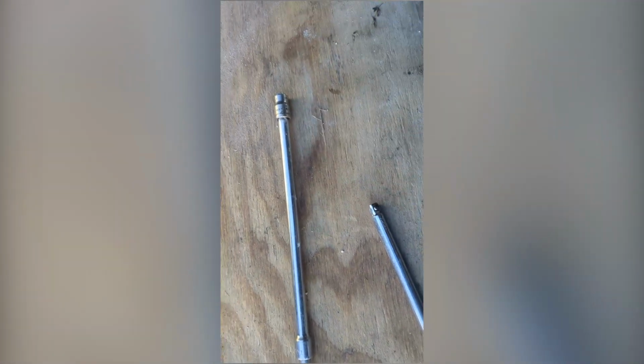Alright, so I end up using 2 extensions, fairly long, probably 12 inches, to get out past the wheel well. And right above the starter, which you can't really see, directly above the starter there's a hole where it went in, and then a bolt hole for it. Had to line up the flange, and couldn't show you guys because my big hand gets in there. You can't see anything. I couldn't see anything. How could I do a video?